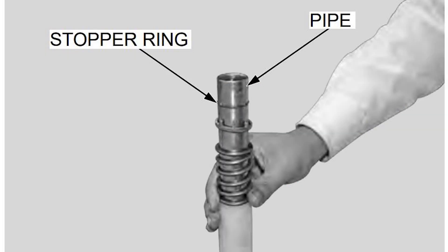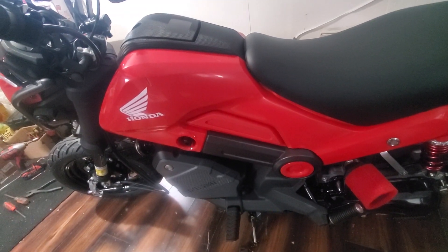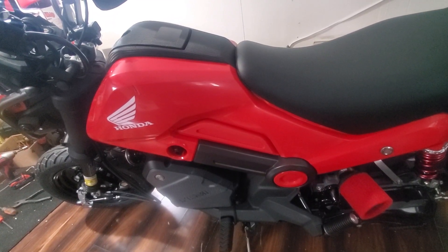I'm sure everybody wants me to answer: how much ground clearance do you actually have if you do this? At its lowest point when it's not tipped over on its kickstand, it's about three inches. Over in the front it's more like five. How does it feel? It feels a little different — it's a lot stiffer. If you hit bumps in the road you're definitely gonna feel it more, but between the give of the tire and the give of the seat it feels pretty good. It also helps that there's another small spring built into the fork assembly itself. The best part is that it's a free mod.